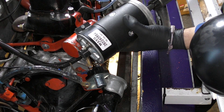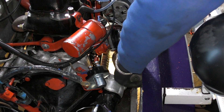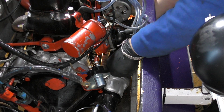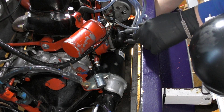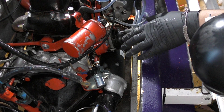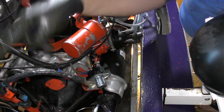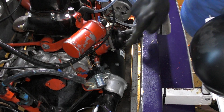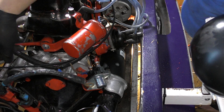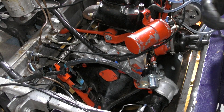I've got the bolts on there for the power feed. I'm going to bolt it up anyway and then we can add the power to it. I'm going to leave it like that for now because when the new battery terminal comes up, it's going to get a cable run from the battery to the front. That will be reconnected because of that frayed wire. I get a terminal from here to the starter motor. I have a new earth strap to replace this earth strap at the back of the engine. I'm going to keep this there and add an additional earth strap because it's a fiberglass body — I want to make sure it's fully protected.